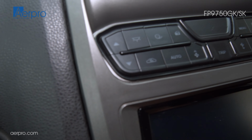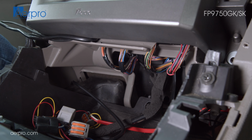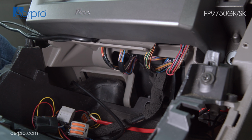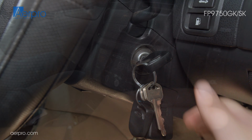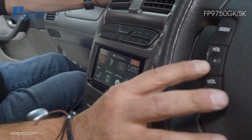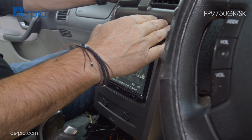We can then gently place the fascia into the space. Connect the 4 cables to the bottom of the body control module, as shown here. Now would be a good time to set up and test out the head unit and buttons before fixing the system to the vehicle, making sure to test steering wheel controls, climate control buttons, and reverse tone if applicable.